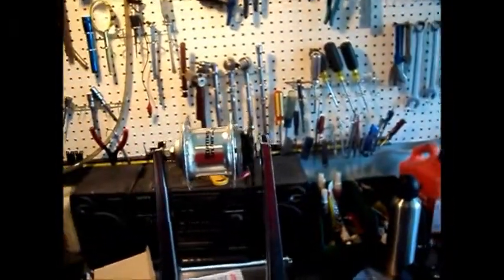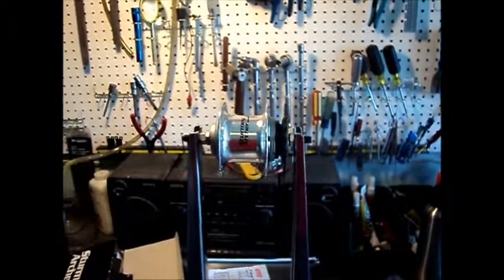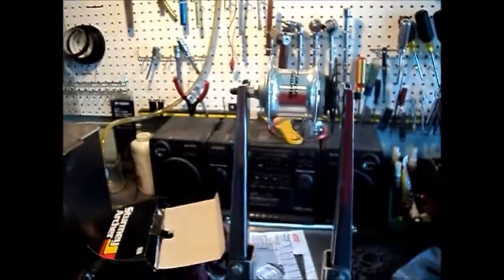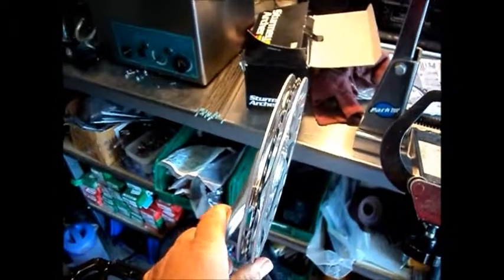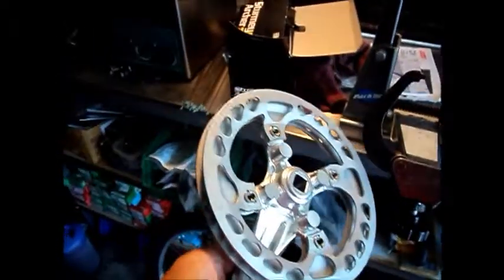So if this was a road bike frame, the 43mm chain line would be about right. But with this style of bike, the issue will be chainstay interference — probably not with the crank, but with the inner chain guard for sure. We might be able to run a 43mm chain line if we took the inner chain guard off, but I would like to leave it on if I can.